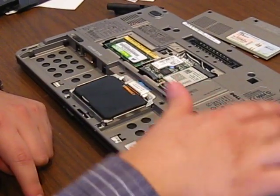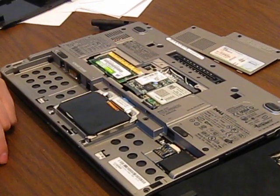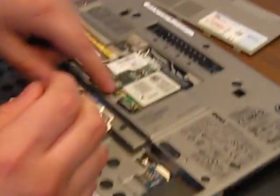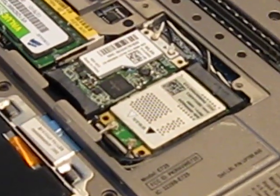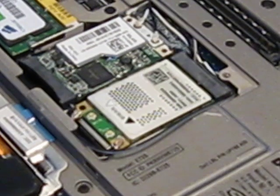It's labeled the WAN card. So on the old laptop, the actual card is right here. You have two wires — white and black. You want to pull those off of the laptop. You have to disconnect them; you basically get your nails in there. They should just pull straight up with very little pressure — you shouldn't have to yank too hard. That right there is the trickiest part.